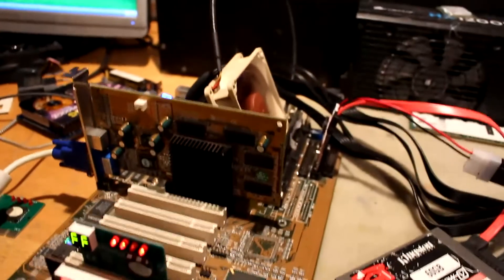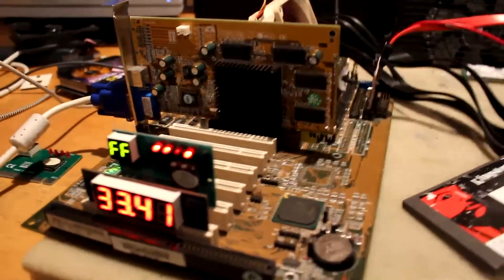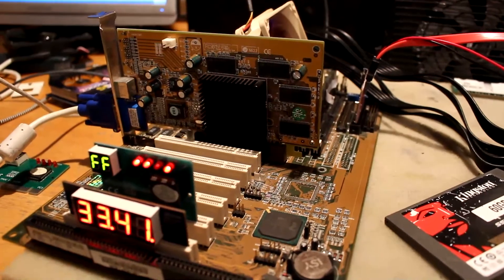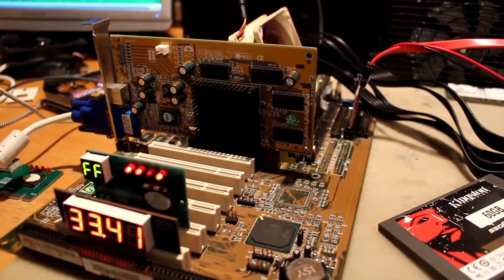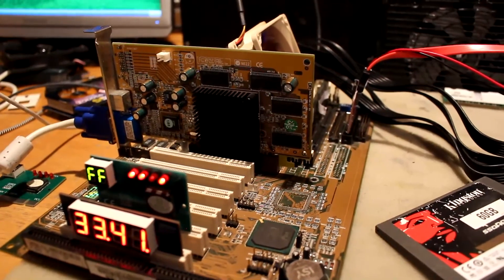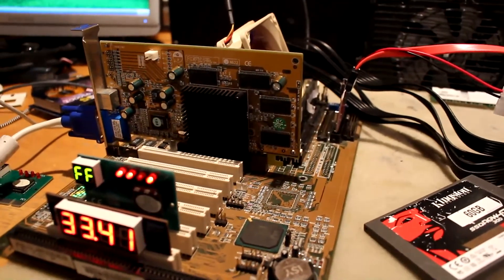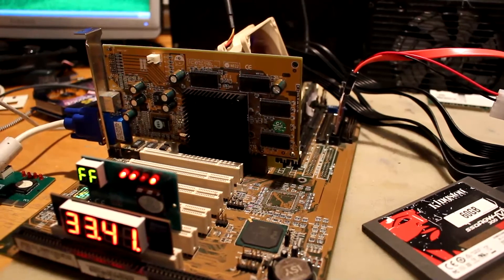I hope you enjoyed this random video and continuation to the Pentium 3 series. I will also do some Pentium 2 stuff - especially because the original Pentium 2s have 4 cache chips and I want to do some trickery there. Also, replacing the tag chip to get past the 512 megabyte cacheable limit and try to run like 1 gig on a Pentium 2. I definitely enjoy messing with this old platform and the possibilities you don't have on modern stuff, like swapping cache, swapping the cache controller, and hardware mods in general. The Pentium 2 system will be back soon.